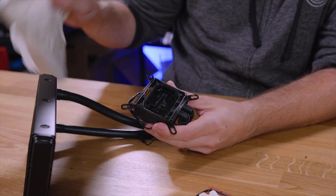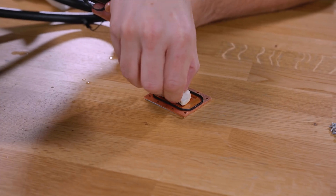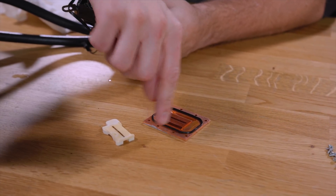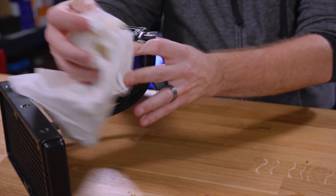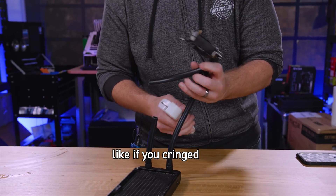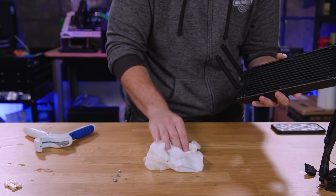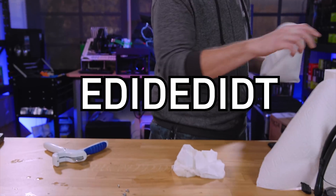This is what the inside of the H100i looks like. It pushes the fluid down through the middle, across these copper fins — they're just really freaking tiny — and then it goes out the outside and back into the radiator. Here is your temperature probe right there. This thing is obviously full of coolant so I'm going to drain this real quick. Based on the way this block looks, I don't think we're going to see any corrosion, but I'm going to cut the end tanks off the radiator and see what it looks like inside.